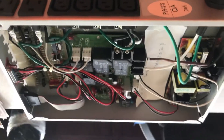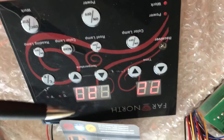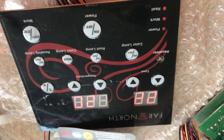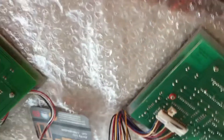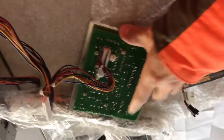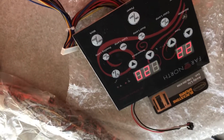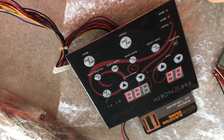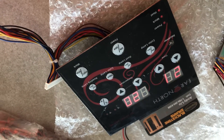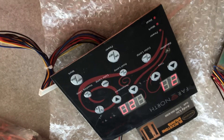So the number one problem that Far North Sauna gets broken is the keypad. The keypad sometimes keeps flashing. What I did is to unplug one of the keypads — basically only hook one keypad at a time to test. Most likely the other keypad will work. The keypad broken only takes about two percent of my total repairs for Far North.